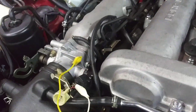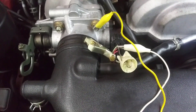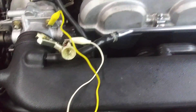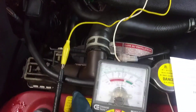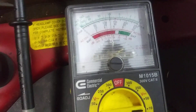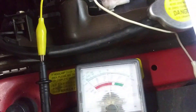The first thing you want to do — your throttle position sensor is right there in the engine compartment, and we've tapped into all the wires on the wire diagram. The first thing you want to do is tap into your voltage wire, which is the green and white wire. I've got my meter set up right here. I tap into it, deposit the lead right there, and ground out the negative lead. You can see that we have five volts reference right there. That's our five volts going in.